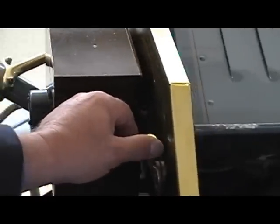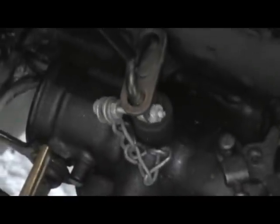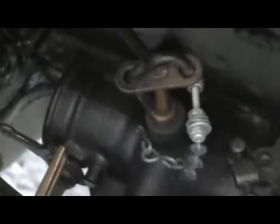I'll show you how it looks on the carburetor now. The carburetor's linkage turns to go ahead and screw in the metering needle so that we could run it on gasoline, or we could turn it out to run it on alcohol. That was as simple as it was to change the air-fuel mixture on the Model T.